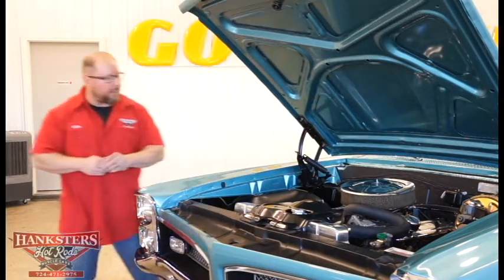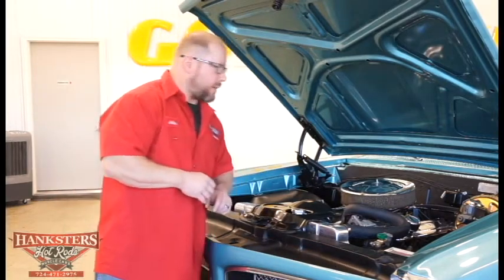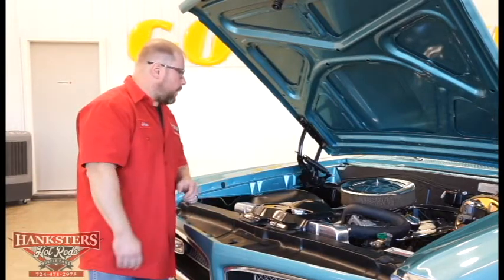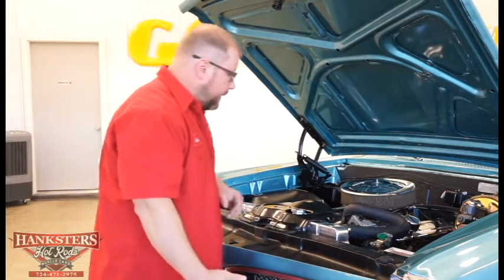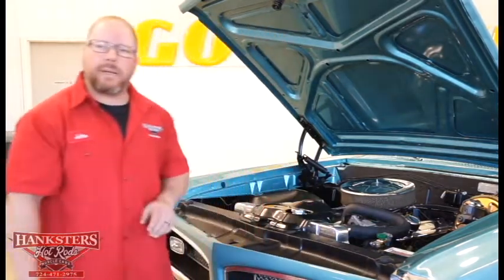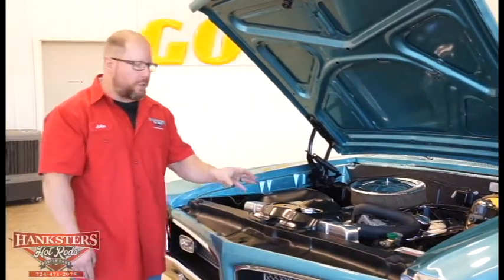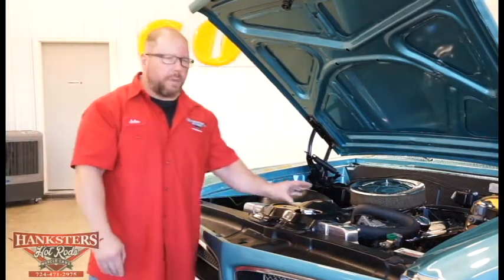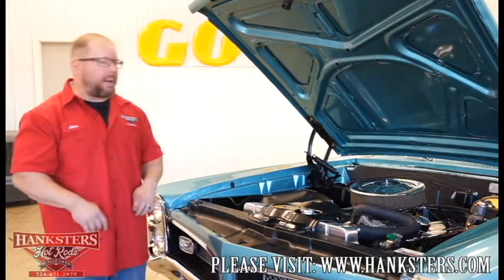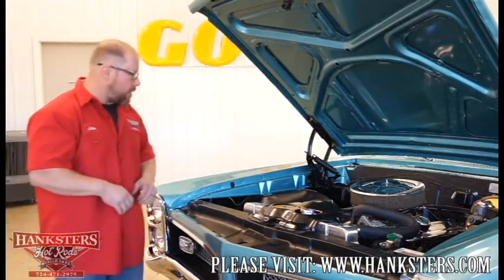We've got a breather, actually breathers, plural, on the valve covers here, so that's going to help vent the heads and the crankcase there for you. And as far as anything else, we've got a good Bosch battery in here. We've got the battery disconnect in them. Those are a good safety feature that we put in these cars. Standard on all of them, only because these cars don't get driven a whole lot. You can disconnect that battery so you're sure that the battery doesn't go dead whenever you're waiting from ride to ride that you take this car on.